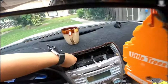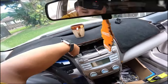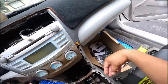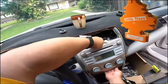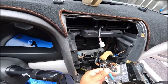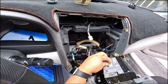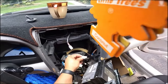The vent came off very easily since it had been worked on before. Up here you can see the two 10mm bolts I mentioned — two on top and two underneath, four total. Take all four out. Now we can pull out the radio. We have one connector for the XM antenna and one for the FM antenna.